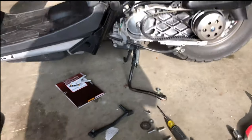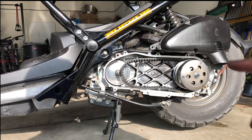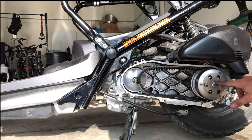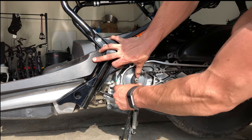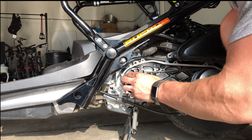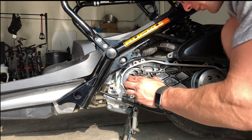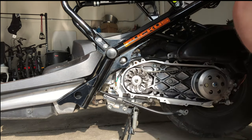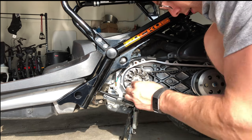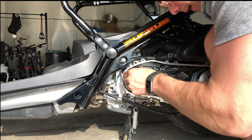All the new sliders are now in and the new Daytona belt is on. It's pretty simple — I just had to remove this screw, torque it down to 30 foot-pounds, and this will get torqued down to 27 foot-pounds once I get it on. I get the belt over top of here — it's a brand new belt so it's going to be kind of hard to stretch at first. Put this back on, just like that, and torque it back down. I'm not going to put the cover on yet because I want to test it, tune it, see if the belt stretches like it's supposed to.